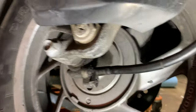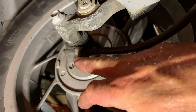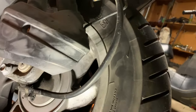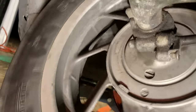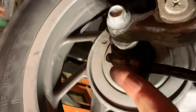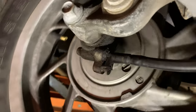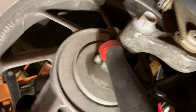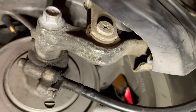There's a couple of spacers and also a speedo cable. Right here is your speedo cable hold-down — you can see mine's broken but it's on there okay for now. You can see the part that's spinning and the part that stands stationary. This piece and this piece are going to be two separate deals — they're going to fall out when you pull the bolt out.